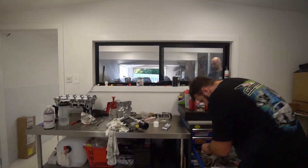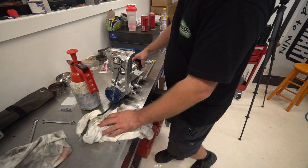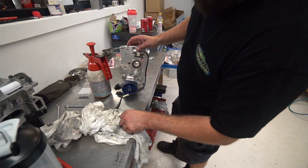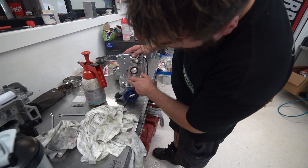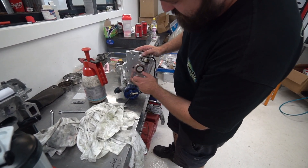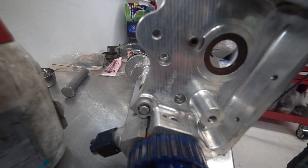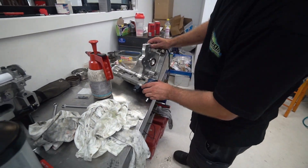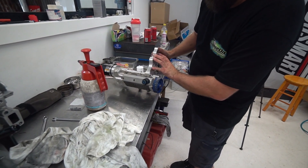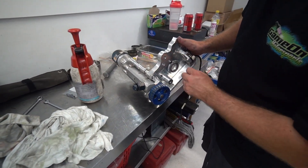So the first thing is going to be the dry sump. We're over here setting it up. This is built by Hasselgren — the H-Power unit on the front here is done by Hasselgren. I think H-Power stands for Hasselgren Power. They've made this front pump unit, which is essentially the dry sump pump bracket and the oil pump seal holder.